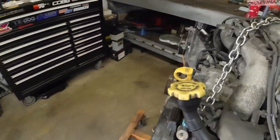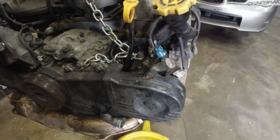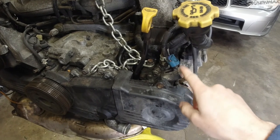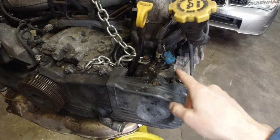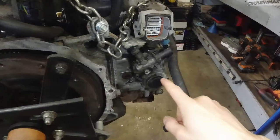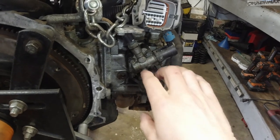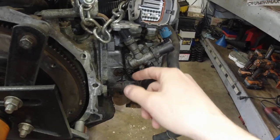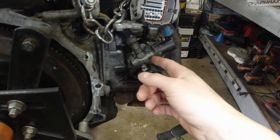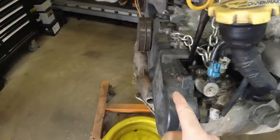And we got a check engine light on for code P0028, which is this variable intake solenoid, this guy here. And now this one is for the passenger side. You can see it's got four bolts. Easy to take out. Take it out. Most likely, well, I don't know what I'm going to do now about it. Well, this one's good. The code is for the driver's side.